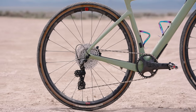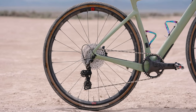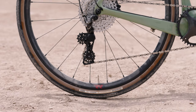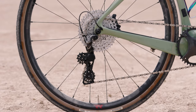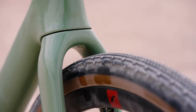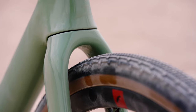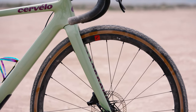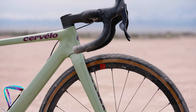Let's start with the tire sizes. Does it do both 700 and 650? It does. Like the Abbotaka, this one will also do 650 and 700. The clearance will be 700 by 40 and then 650 by 49, so good range there. And to keep the ride similar for each tire size, they have a little flip chip in the front fork — you can just unbolt it there and flip it around and it should ride similar for each wheel size.